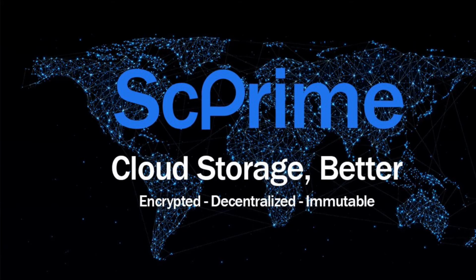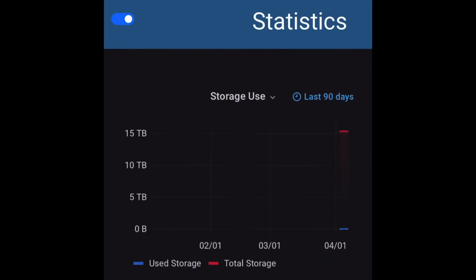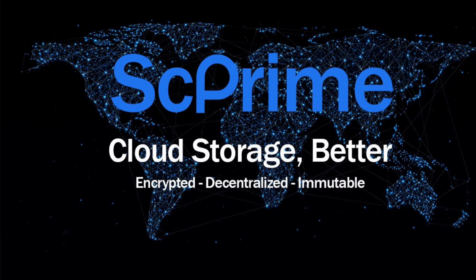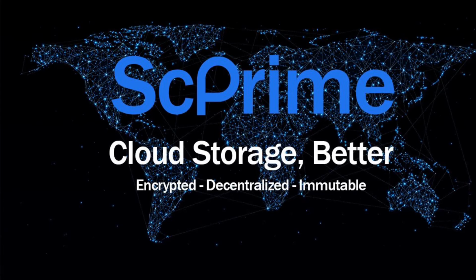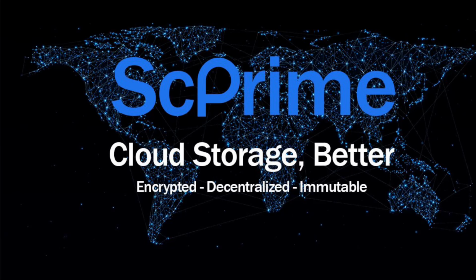One thing that can be handy is that in the Grafana interface, you can also see your hard disk temperatures. So if you start playing around with the fan RPMs, probably a good idea to keep an eye on those hard disk temperatures to make sure they don't really get above 50. Ideally, you want your hard drive temperatures to be somewhere in the 30s, and preferably not any higher than the lower 40s.